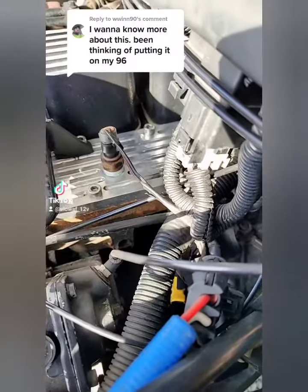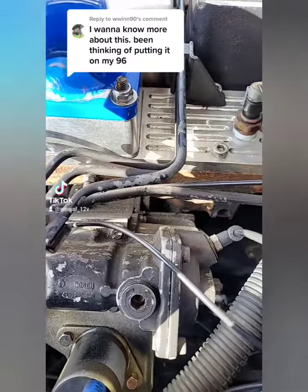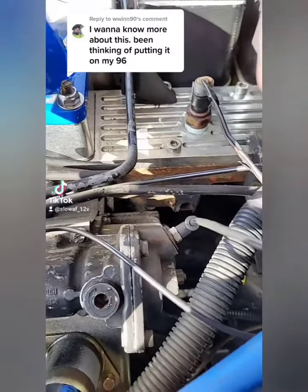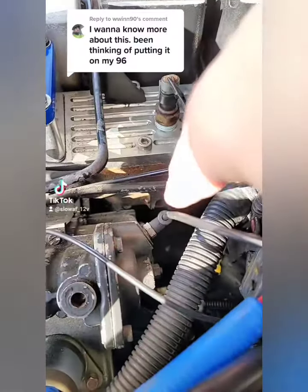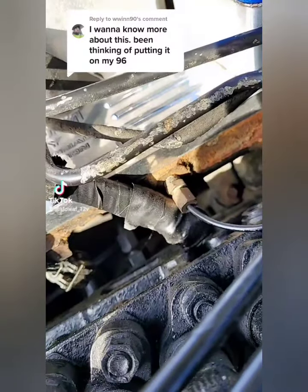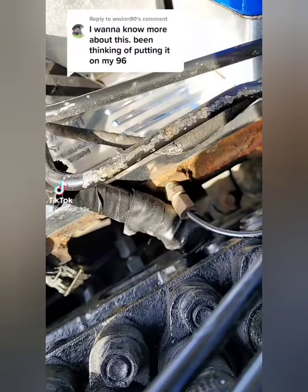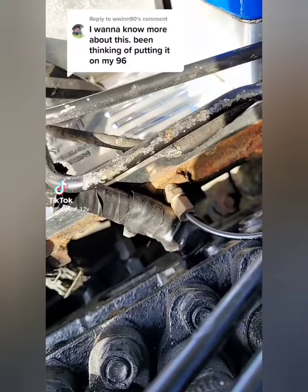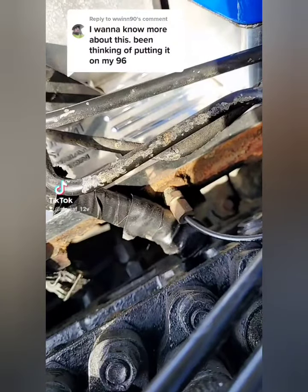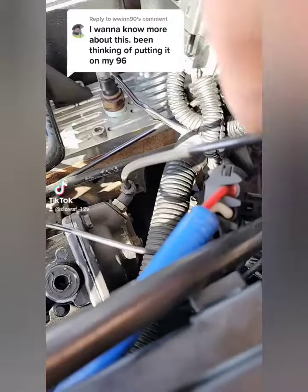As far as the install goes, if you've already gutted the AFC housing and pulled the fuel plate, you can pretty much leave it as is. You're going to swap out the fitting on the back side of the AFC housing as well as the fitting mounted into the intake shelf. That line right there — which is usually a boost reference line for your AFC — is now going to run from one end of the AFC Live back into the back side of the AFC housing.